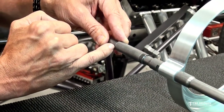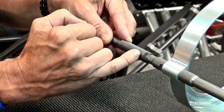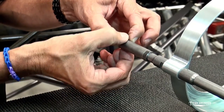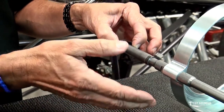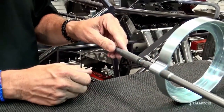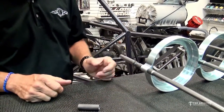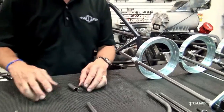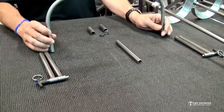You're also going to want to cut that short of the floor. If you use this full height, cut it about a half inch shorter so it doesn't go all the way down. When you weld the bottom portion, it's going to pull in just a little bit and get tight. The last thing you want is to have to wiggle the mount to get it out. If you cut it a half inch short, it'll slide in and out easily. You'll get this extra tubing to mount it to the floor of the chassis.